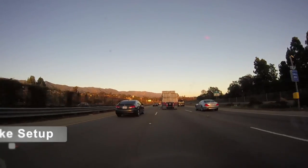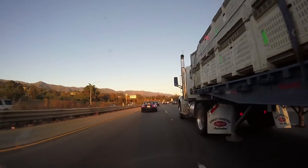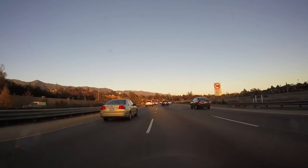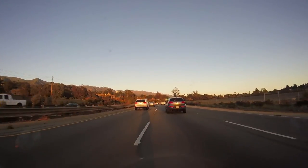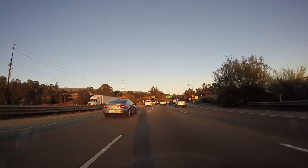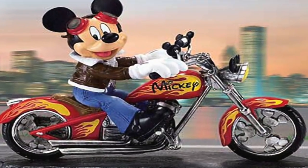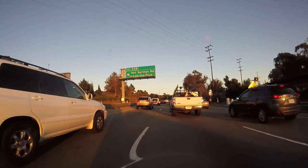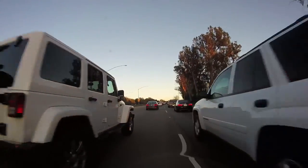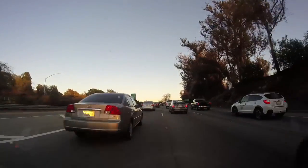From there, let's talk about bike setup. You can really help yourself if you get your mirrors in the right place. Usually if you're going to clip somebody, it's going to be your mirror into their mirror. What works best for me is to move my mirrors out far enough so I can see past my elbows — most bikes come stock with mirrors staring at your elbows. You can buy extenders to move them out about an inch or so. Beyond that, you're just asking for trouble. On my bike I have little wide-angle mirrors for blind spots — get them at the auto parts store and double-sided tape them on. If you clip one, just knock it off and keep a spare in your garage.